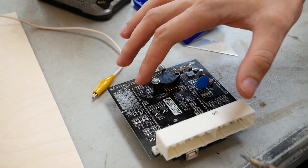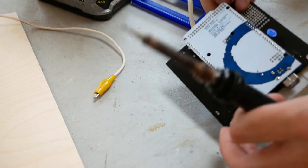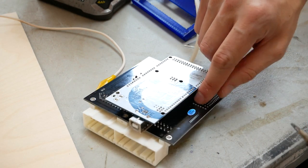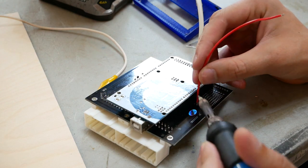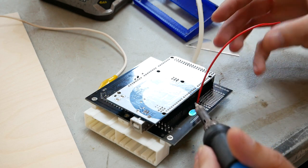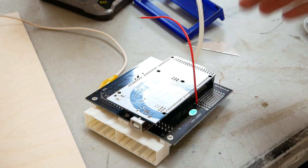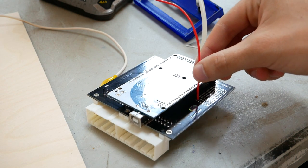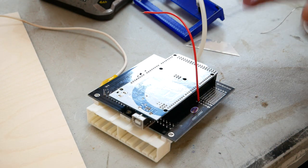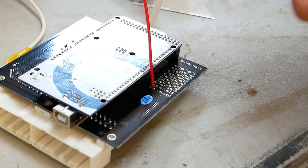I'm going to wire mine on the back of the board because it will look a little bit cleaner, so I'm going to pay attention to where that boost control area is. Flip this over and I can tell that it's that second pin in right there and that's where we're going to be putting our jumper wire. I have my wire prepared here — we're just going to put this down in this hole, heat that up, get some solder on it. Now you'll probably note that I am not an expert solderer but I think that's going to work pretty well. Give this a tug — that wire is on there and we're making good connections. Make sure that you don't jump across areas to wire in here because you won't get a good signal and you'll start to have problems. Also don't put too much heat into your board.